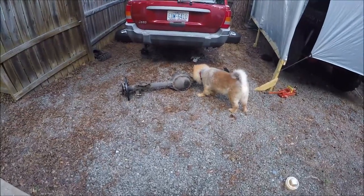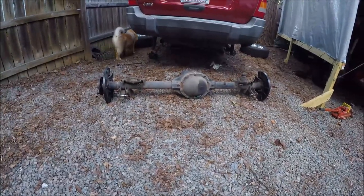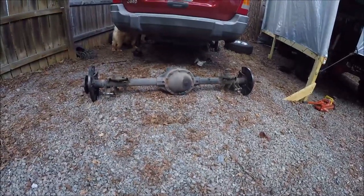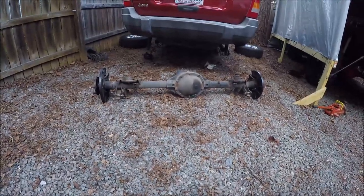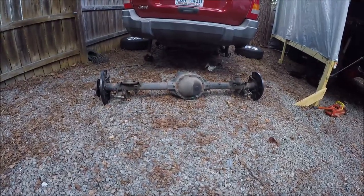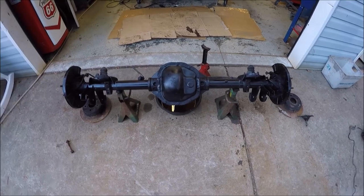The shop dog is checking it out. We've got the Dana 35 out from under it, as you can see — not a very beefy axle. The problem with these is the axle wall tubes are thin, so the tubes will bend. The axle shafts themselves have small diameters, and I don't know — they use some sort of cheap metal, because you go four-wheeling and next thing you know you've twisted a shaft. So this will be a good upgrade. You can see the size difference — even the pumpkin is bigger, so we've got a larger ring and pinion, better strength, and the diameter of the axle shafts are actually a little bit bigger too.